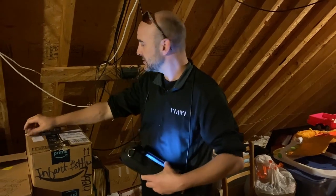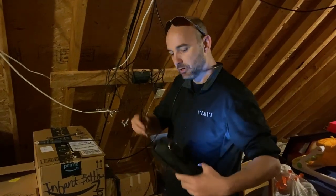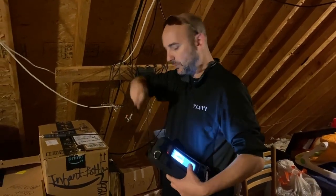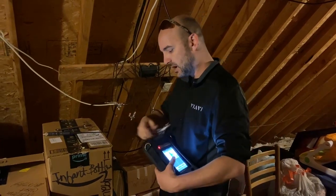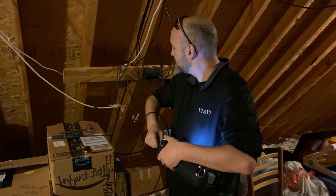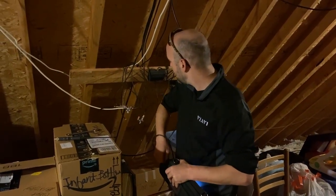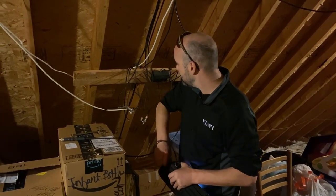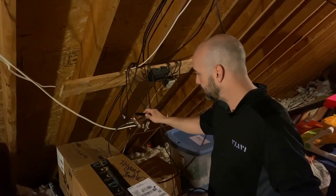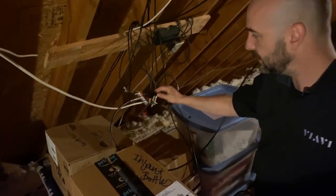The reason I'm doing this is because there's a bunch of cables, connectors, and all kinds of things in here. So what I want to do is hook in my near-field probe. The near-field probe is what's going to allow me to really touch and feel around to get a pinpoint of where the actual leak is coming from, or a loose connector — which I'm going to assume might be what it is. There could always be a rodent chew up in here. Now I'm going to wand over and I can start to see that there's definitely a leak here.